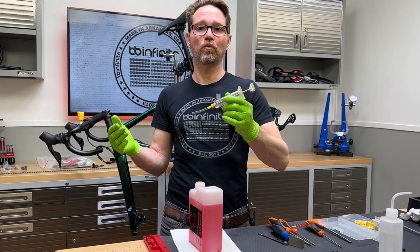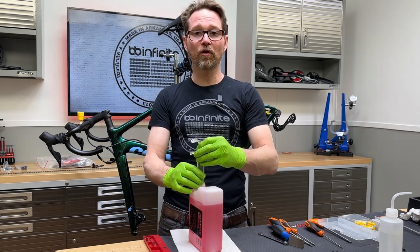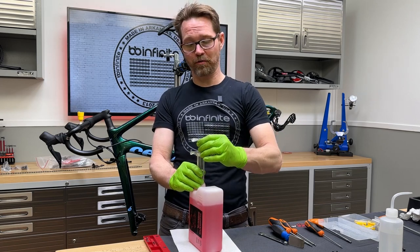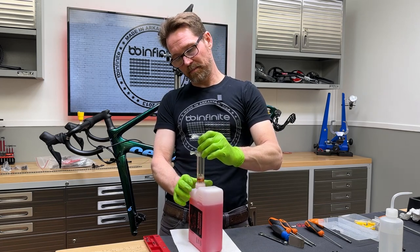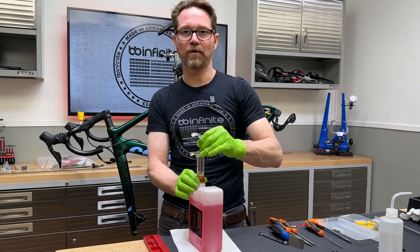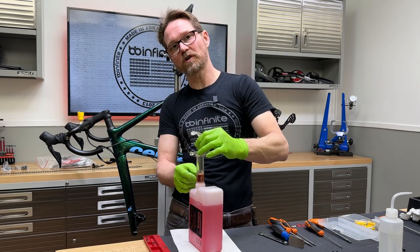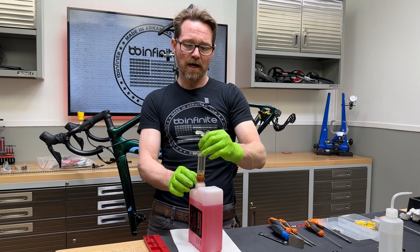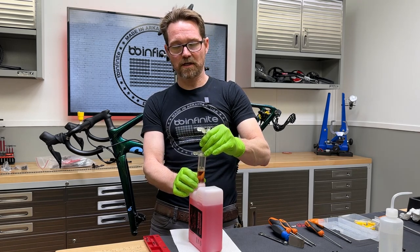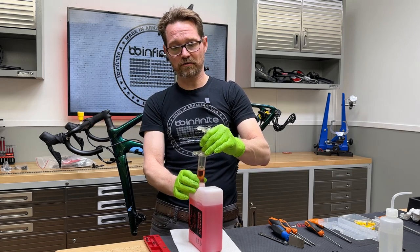This video has to do more with the principles of brake bleeding and it's not really a primer on any one system. The principle here is: when you're sucking fluid up into the syringe, do everything you can to make sure you don't aerate it. That means don't pull up on the plunger as fast as you can — really ease it in. If you start seeing some aeration happening, set it upright and let all the air bubbles slowly filter out and collect.